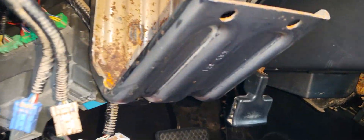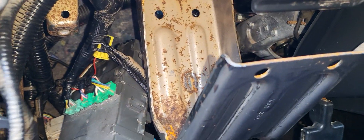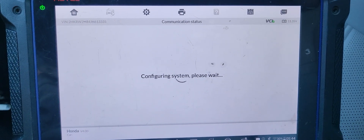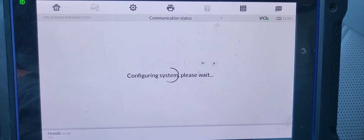Flood is not a joke. When you have a flood in the car like this, try to knock down everything and then go into all the modules and fix them one by one. I don't know if they changed them or put new ones, but all those modules have to be replaced — depends how far the water went. Till now I'm not able to get into the immobilizer system. Could be internally they messed up. If everything is okay, it will read the immobilizer system and tell us how many keys are inside and what we need to do.